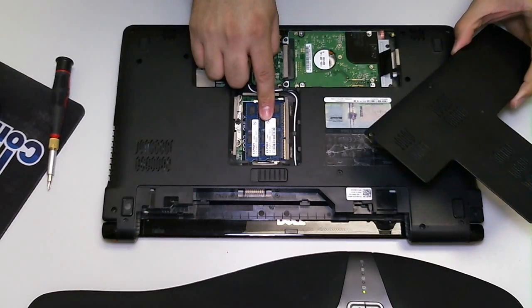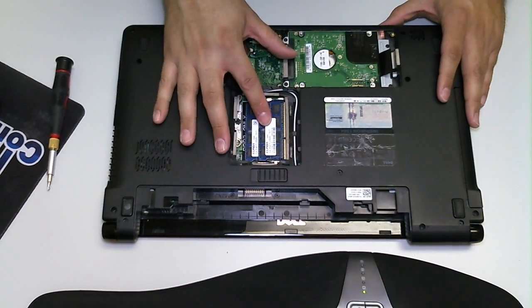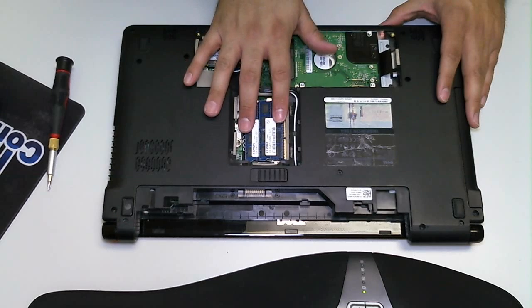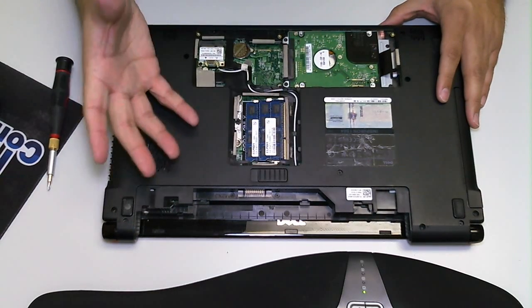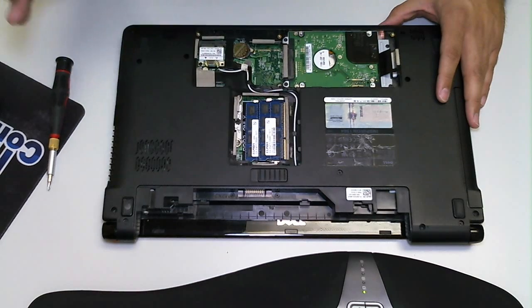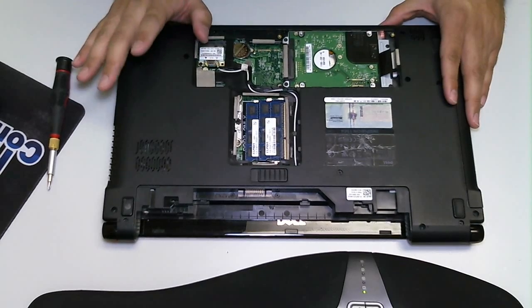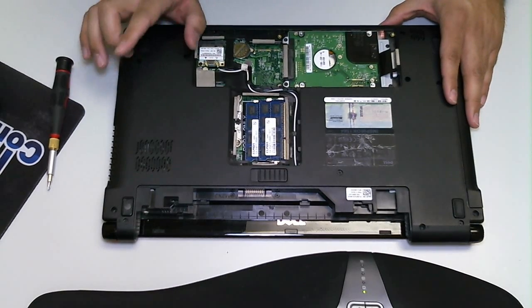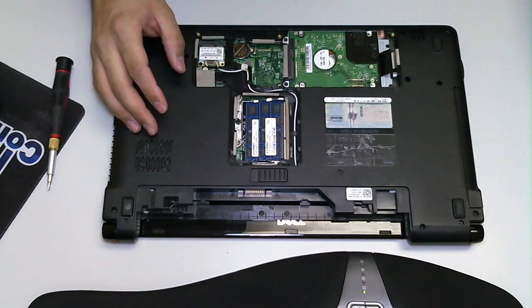You've either upgraded your RAM or replaced it. On a 64-bit OS, this will support 8GB of RAM. Right now this has two 2GB sticks, but you can get an upgrade kit at Fry's or any other electronics store — it's not too expensive to get 8GB on this system if you have a 64-bit OS. Make sure you do have a 64-bit OS that supports that much RAM.